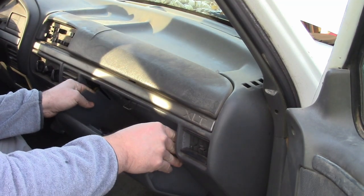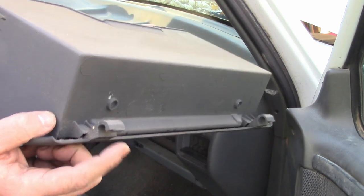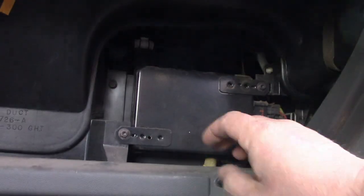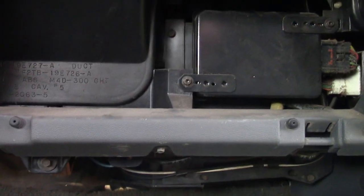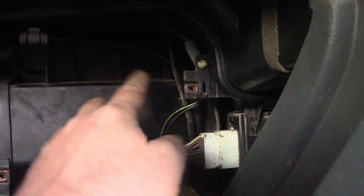Pinch these in — you can slide the glove box down, and then the hinge is just a little hook. Looks like there's some stuff in our way. Let's take this module out. Seven millimeter fits it pretty good. I think this plug needs to go too because we're trying to get this whole cover off here — either way down here, all one piece.